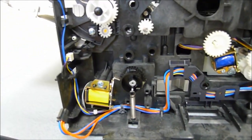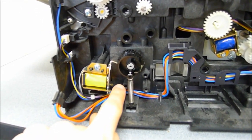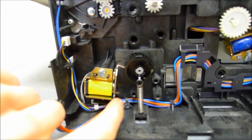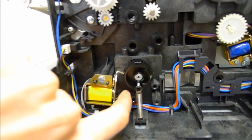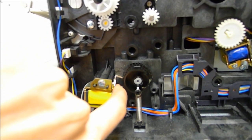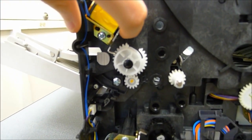Because printers depend on millisecond or less time differences, obviously everything goes downhill from there. If you watch what happens here, basically when I release this it should snap back right away, but if it sticks hard — you see how there's a delay when I release my finger from that — that's what's causing the printer to jam.